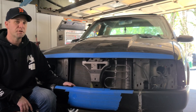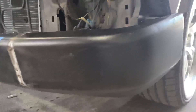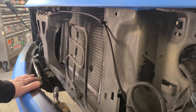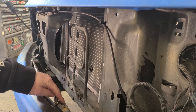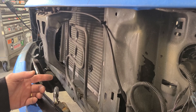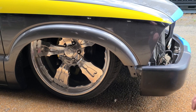Back at it today — turned a major corner on this bumper yesterday. Managed to get both sides even, got the other side tacked up, things are looking good. Made a new template that goes around both sides so I can verify the shape is even all the way around. Now that I have the shape of the bumper going in the right direction, time to start mounting this thing. These are the frame horns — measuring up off the hood I realized one side is a little bit higher than the passenger side. So I've got a variety of shims stacked in here to try to get the bumper running parallel with the hood. The sides of the bumper are going to run parallel to the fenders and extend all the way out to the wheel well with about an eighth inch reveal on the bottom — that eighth inch reveal is what's going to actually dictate the height of the bumper.